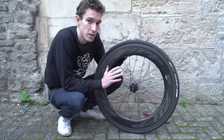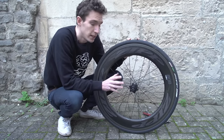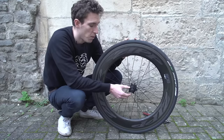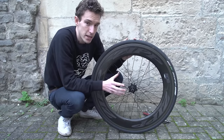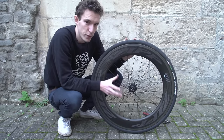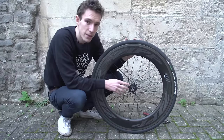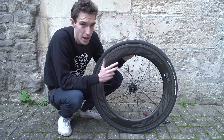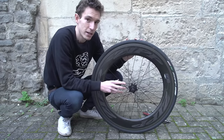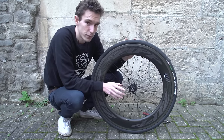If you're replacing your cassette with a new cassette, there are one or two compatibility issues to think about. The first is how wide your freehub body is — so how many gears you can fit on it. 11-speed gears require an 11-speed freehub body, as those are the widest. You can put a little spacer in and use an 11-speed freehub body with a 10, 9, or 8-speed. 7-speed cassettes are narrower still and require a completely different freehub body.